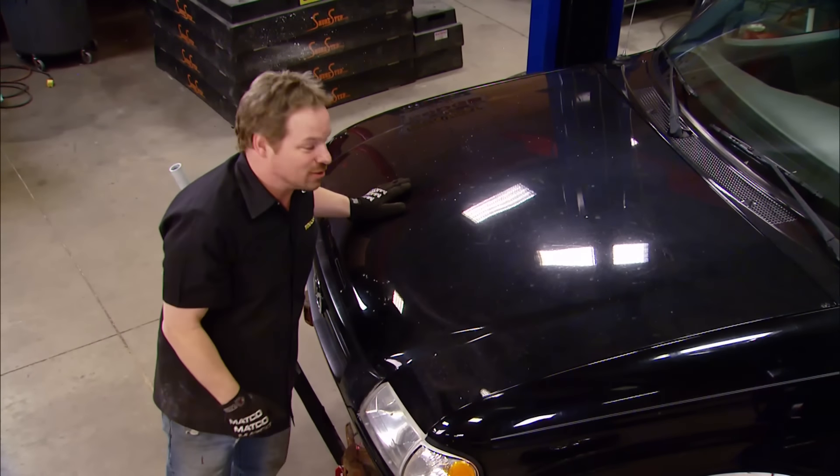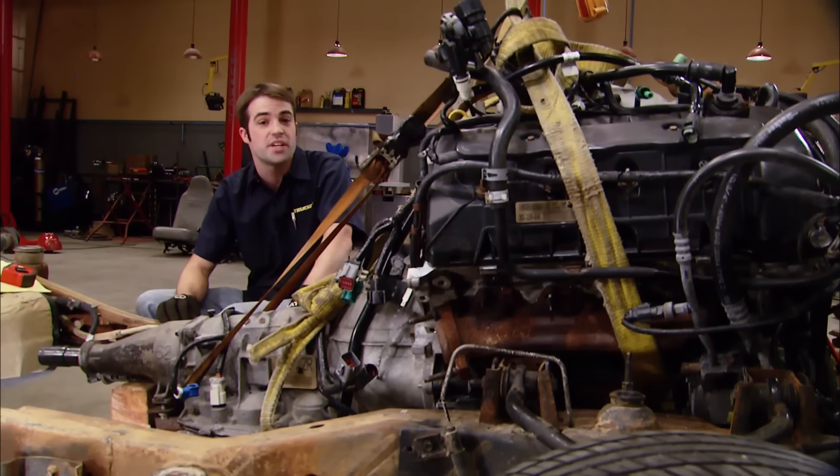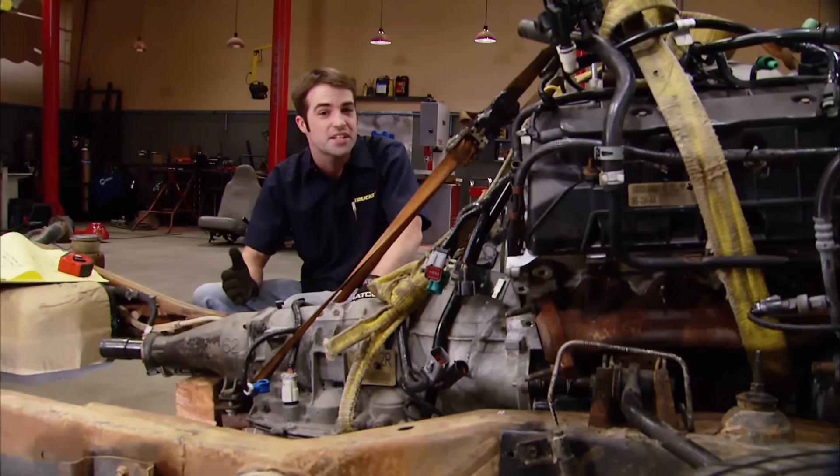There is a stealth factor. We've gone ahead and taken some measurements on where the engine is sitting right now because we know it fits and we don't want it to move. Before we start building engine mounts, we want to see if we can get this factory Mazda cross member to line up with the Mercury Marauder transmission mount, because as it sits right now it's pretty darn close. The bolt holes look symmetrical, so we may be able to drop the cross member, flip it 180 degrees, and reinstall it. And even if that doesn't work, the bolt holes for the mount itself are drilled offset of center, so we may be able to flip that around as well.